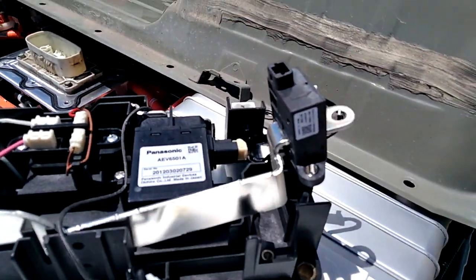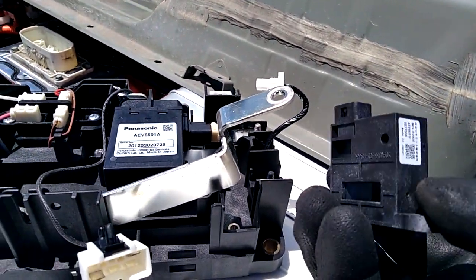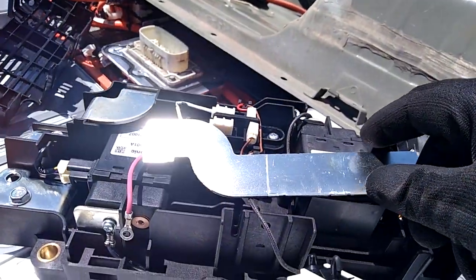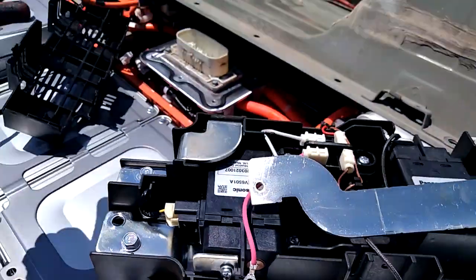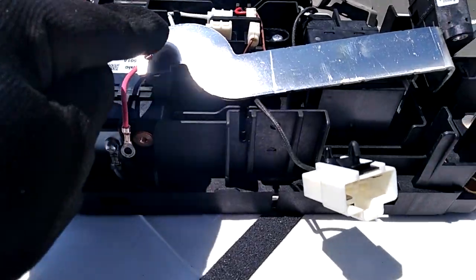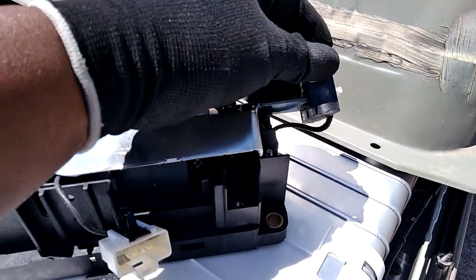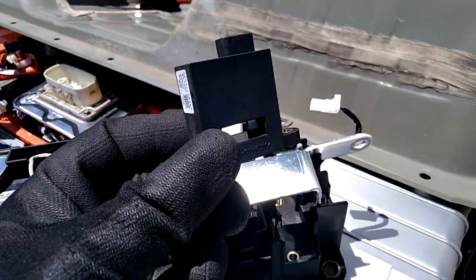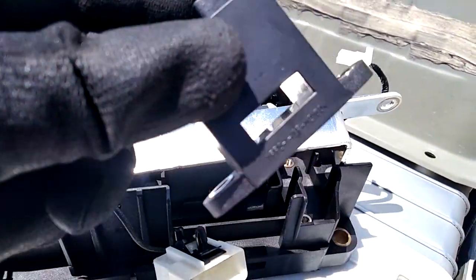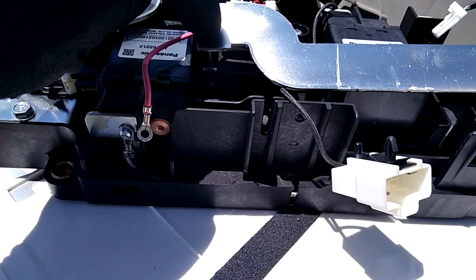Here is the guide that helps in doing the current sensing. Now I need to decide: am I going to make a new hole somewhere here to put my own cable? That cable over there — yes, I have to find a way to get it here into this place. Do I just remove this sensor and plug it somewhere so it will be sensing nothing? No, that's not a good idea — it would think nothing is going through it, which could be dangerous. So I'm going to do what my friend did, since he's already getting good results. I'll add my own cable.